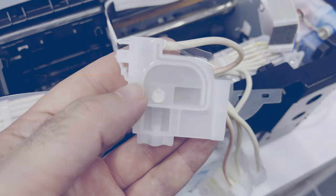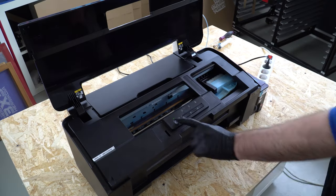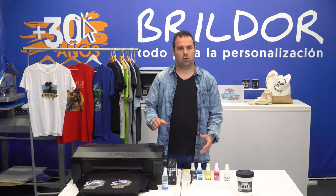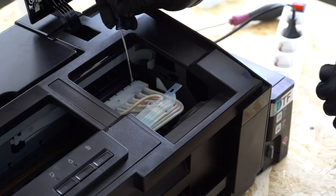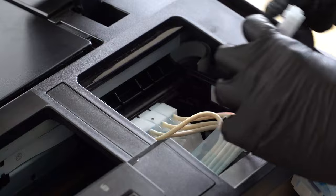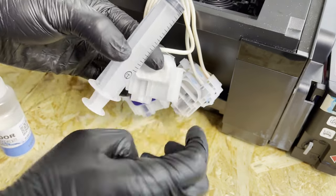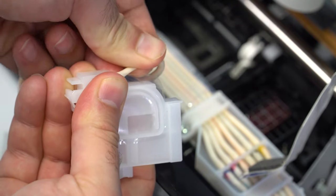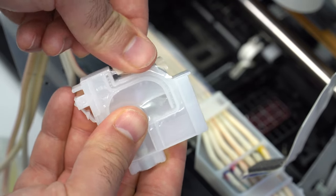Shaking or replacement of the dampers: shake the dampers at least once every 15 days. To do this, turn on the printer and when the head unlocks, unplug it. We recommend using a power strip to avoid damaging the connection when pulling. Bring the print head to the working position. Remove the screw from the cover and with the help of a flat screwdriver, loosen each damper. Now shake them to prevent sediments. Make sure there is no air in them — if there's any, you can suck it out using a syringe. If the dampers have a lot of sediment, you may need to replace them. Simply attach the hose and place it in the new one, then reassemble everything.